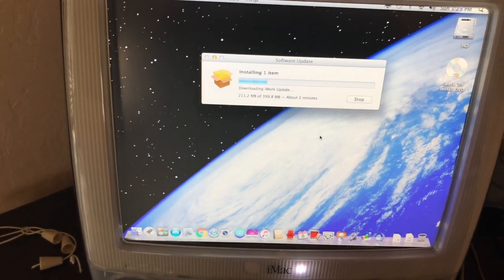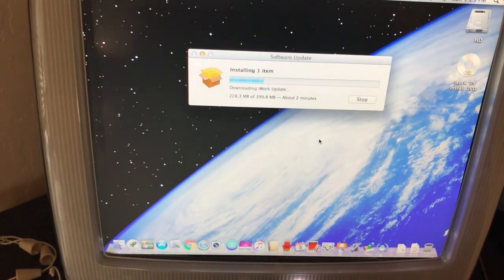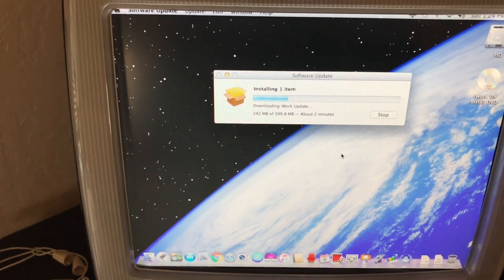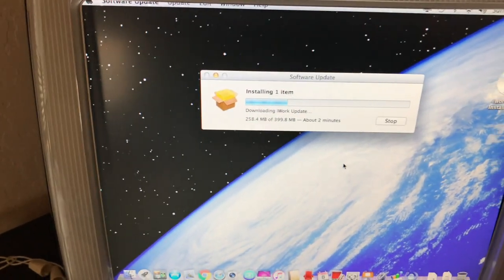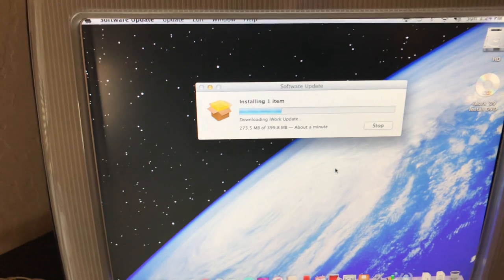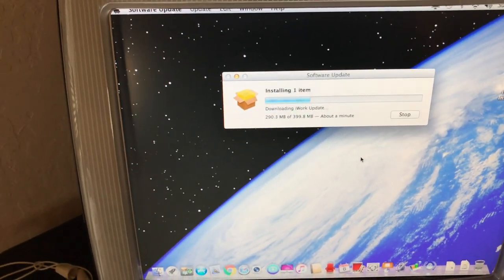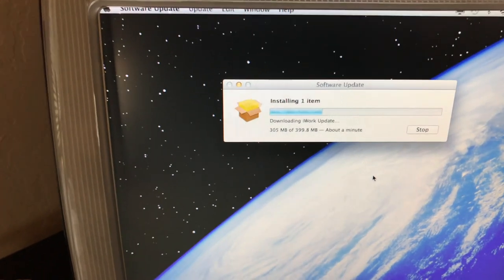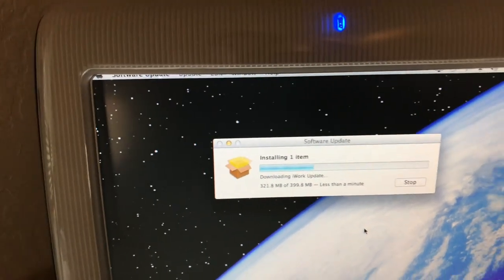This has a mechanical drive in it. When I put the Mac Mini in, I got it on the cheap — didn't really put too much money in it. It's slow, but it works. Normally on my older machines I always put an SSD in them, even with IDE interface — I'll put an IDE-to-SATA adapter on it. It makes the system a lot more snappy, because it totally saturates the system and you get every bit of speed you can out of it. With the SSD, that iWorks install probably would have wrapped up 10 minutes earlier. It's amazing the difference — how snappy applications open, instantaneous.